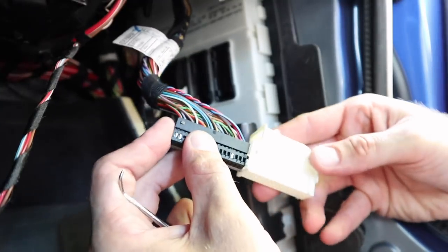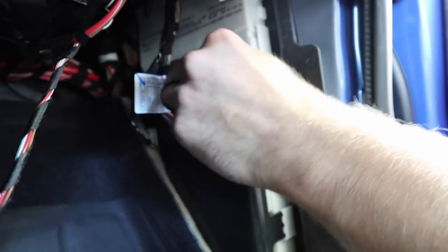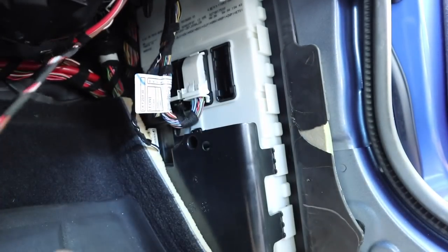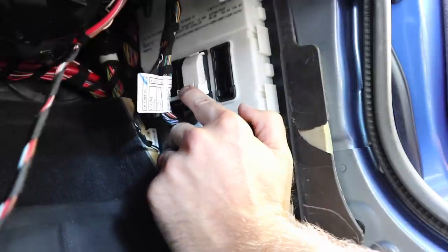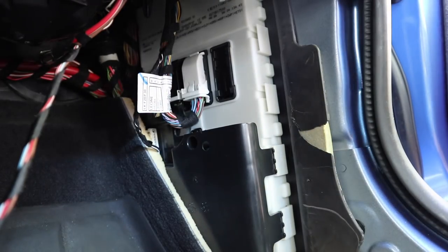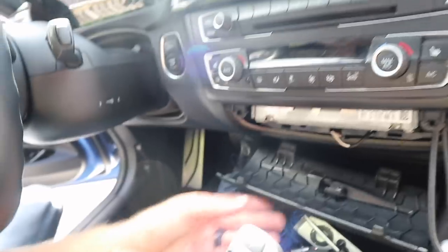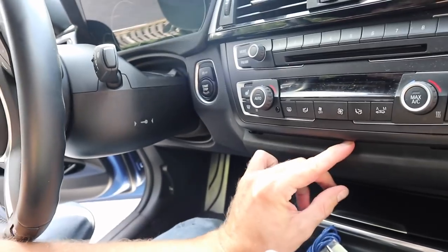Once that's all done, line up the grooves, slide the cover back into place, push in and push the lever down to make sure it locks. Then put the kick plate back on. Next, use a coat hanger or wire feeder and feed this wire all the way through to under your steering wheel. When feeding the wire from the passenger footwell to the steering wheel, run it along here and zip-tie it nice and tight. You can also rock out the lower dash panel by prying it with a trim tool — it has two hooks — to help guide the wire up.